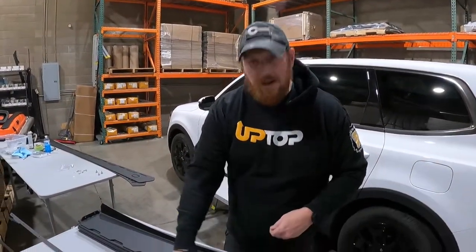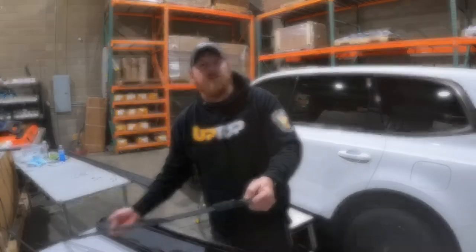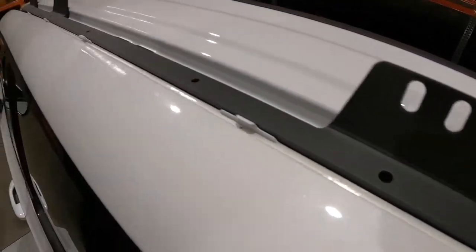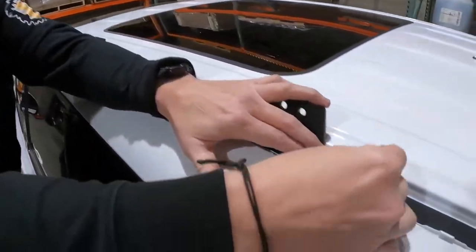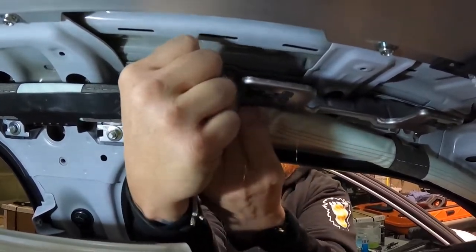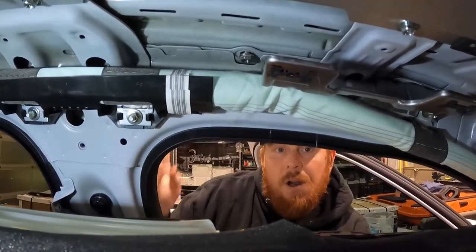The spines included with your kit are indexed for driver and passenger side with mill machine marks on them. The D is for driver, the P is for passenger, and the engraved side of the letters goes to the front of the vehicle. Grab the hardware you put the thread locker on and install the spines. Locate the rear hole of the spine over the rear hole in the drip rail — the middle and front ones will automatically line up. Push your hardware into place underneath the hole, then go inside and install the nuts. Each location gets a fender washer and a flange nut — slip the fender washer over the stud, install the nut onto the exposed threads by hand, then finish with a ratchet. Do the same at the middle and rear of the vehicle, then do the passenger side.